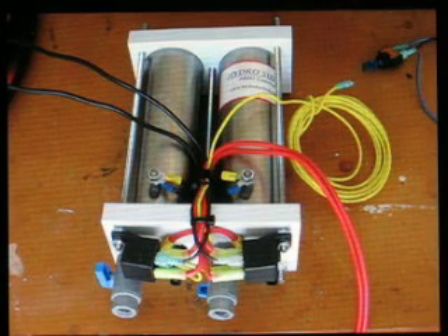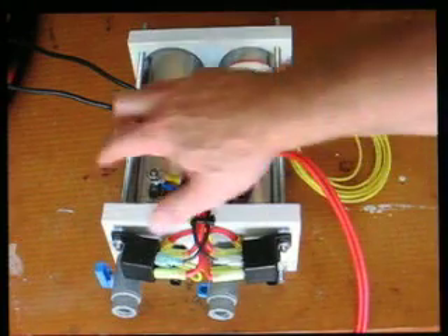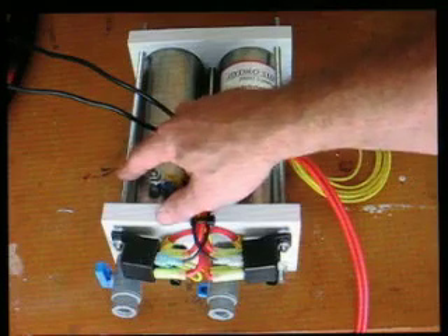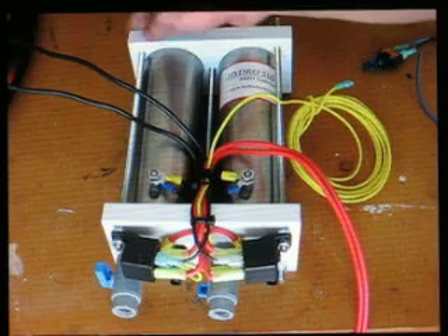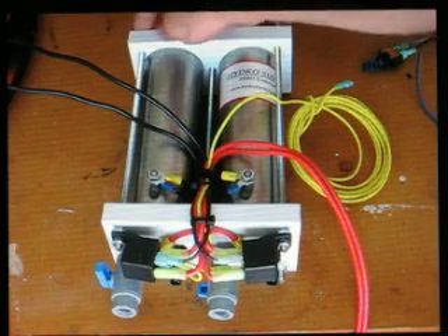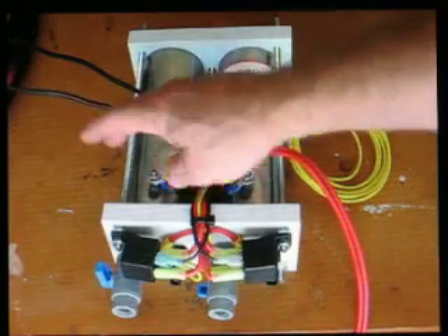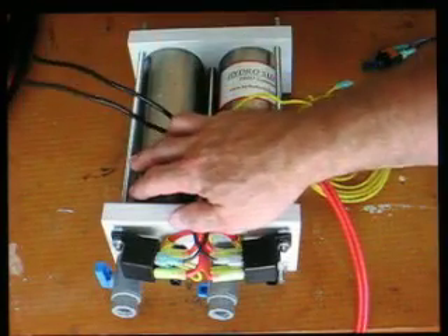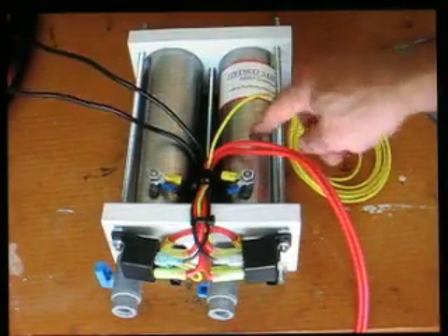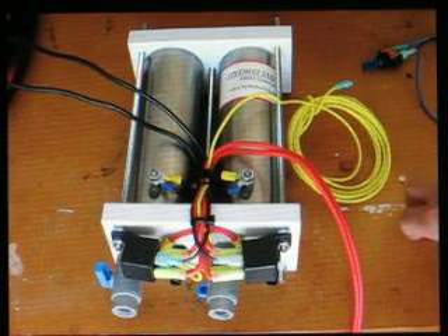To clean the inside of the cell, I just took off the top cap. Pretty much the only tools you need are vice grips — just to keep the center bar, because this bar goes all the way through the entire unit. If you try to just undo the threaded part, it's got a nylon nut at the top that'll cause the entire bolt to spin. So you just easily clamp it. These threads really don't come into play, so you're not going to hurt anything. Use a 7/16ths wrench or socket — whatever you want — to pop the top off. Make sure you don't lose the O-rings.